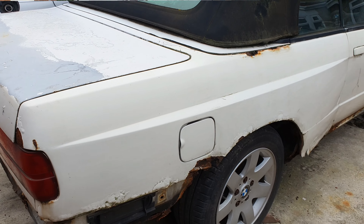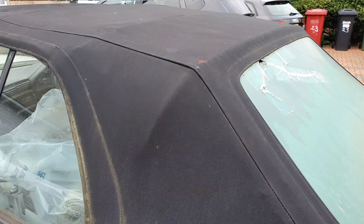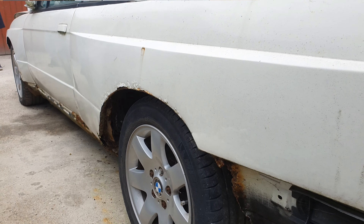We checked from underneath — it's okay, solid. The car is rusted from the rear arches, the sill soles, and the rear panel — the light panel which is rusted. So the plan is we're going to strip this car. We've already started stripping — we're taking the front and back bumpers off, taking the front wings off, and we're going to cut the rear quarters out.